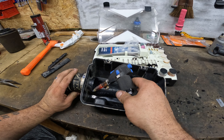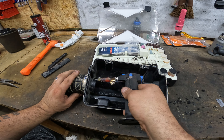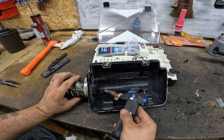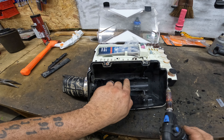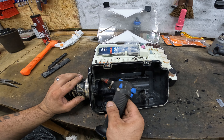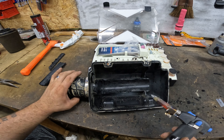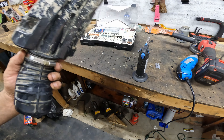So the best way to smooth out these edges once you've got everything cut — just smooth it out, take the roughness off. They don't have to be perfect; you ain't going to a pageant show. Don't get too close because you will go through the plastic to the other side. But don't worry if you do go through — you can fix it with plastic welding. It's easy.